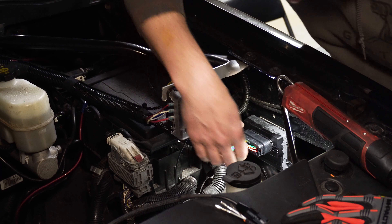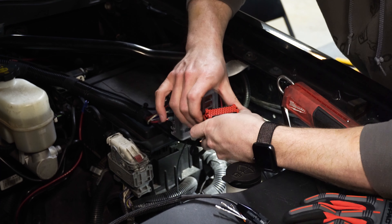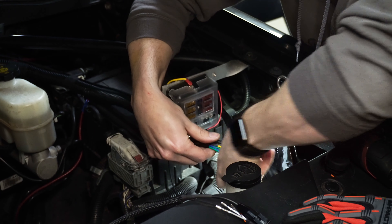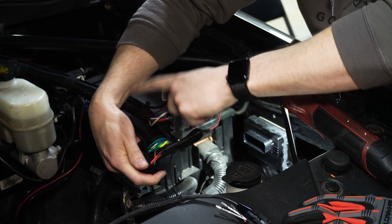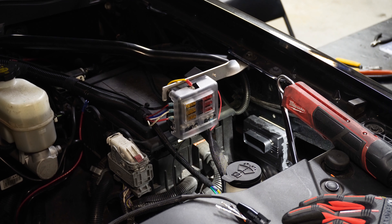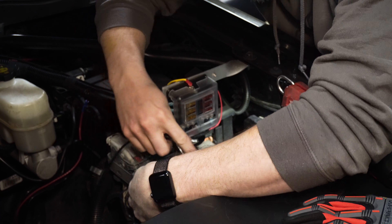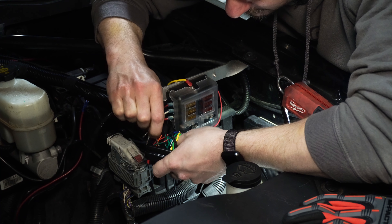We should be able to just push these in without removing the front comb on there, so we're going to try. Look at the back side — it's numbered. One is up here and all the way in the other corner is 35, and it just goes in order down through there. So let's see what we need to put where. Our sensor voltage goes into pin 28. So our gray wire is going to go into number 28. We come down here, find 28: 24, 25, 26, 27, 28. Double-check it before we seat it: 24, 25, 26, 27, 28.